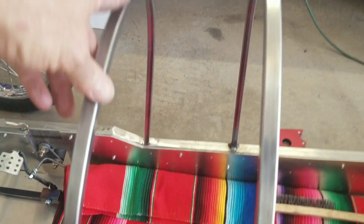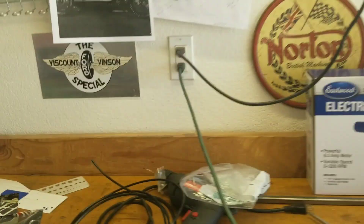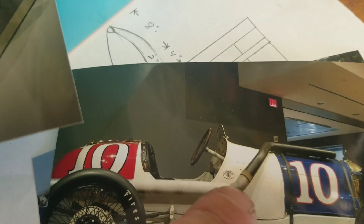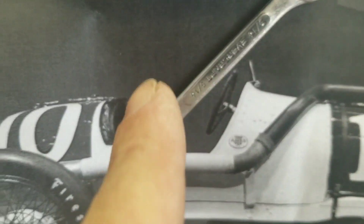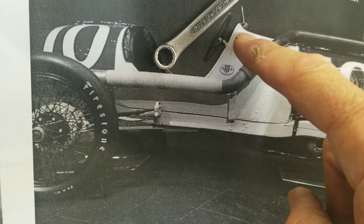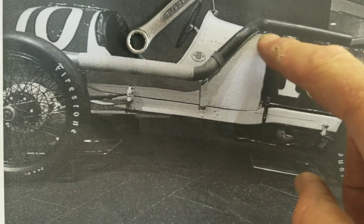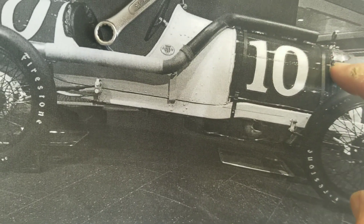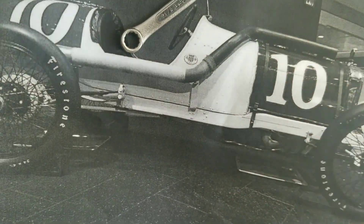That difference in height from one hoop to the next is going to create a slope — on the inspiration cart you can see the slope that happens right there at the cowl, at what would be a windshield. It flares a little bit right there, and I'm trying to capture that. You can see that the main pipe I just put on is about where that slope starts, and it's going to flare up from there close to the steering wheel, then drop a little bit down. From that point forward it's pretty well level — that's where the hood is going to go in at the grill. The second piece is one inch lower than the first to create that little bit of slope in the cowl area.